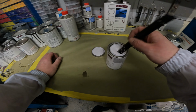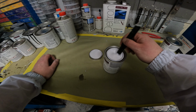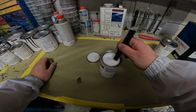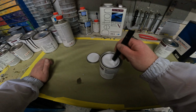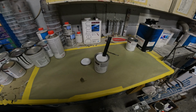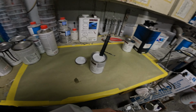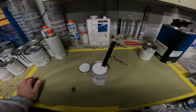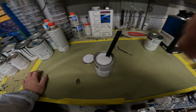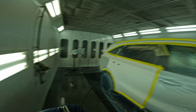So what you gotta do is you gotta make sure that your underlayer color, your base color, the white, is a very good match first. The last thing you wanna do is get putting pearl on there and noticing that your blend's just not going away. And there's no amount of pearl that you're gonna put on it to get rid of a bad base coat color. So I want everybody to be aware, and that's the second tip, guys. Again, it's all about cleanliness.